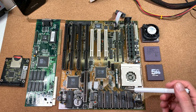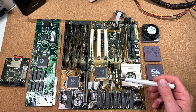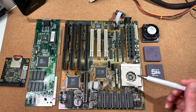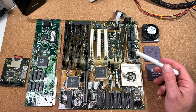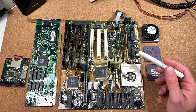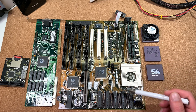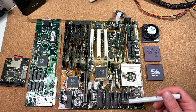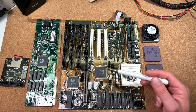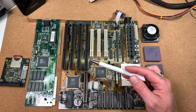Let's have a quick overview of the mainboard. The revision I am using here is 1.2. Actually there are several revisions existing, and not all revisions are supporting overclocking or running stable overclocked CPUs. This board is equipped with two 8MB fast page memory modules with an access time of 60ns, which should be fast enough to max out the values in the BIOS. There is also 256KB of level 2 cache with an access time of 15ns. Unfortunately, the PCI implementation of this chipset is not the best, therefore I am using the VESA LocalBus for my video card.